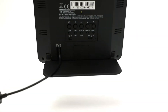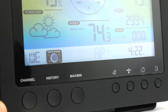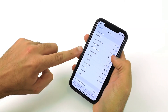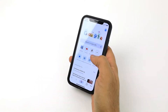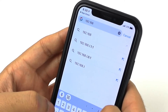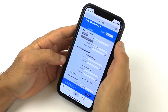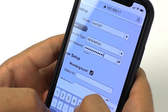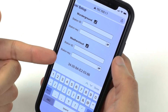Let's get you connected to your home wifi. Press and hold the sensor wifi button for 6 seconds. The console will display the letters AP. On your computer or smart device, go to your wifi settings and connect to the network PWS followed by a series of letters and numbers — each device will be different. Once connected, open your browser and type the following: 192.168.1.1. A settings page will appear which will allow you to enter your home network's wifi password. You will also be able to come back here once we've registered with Weather Underground or Weather Cloud Station and received our ID and key.